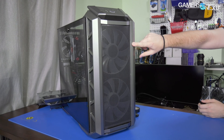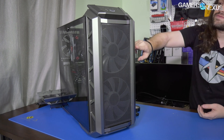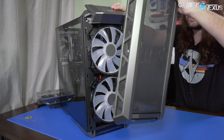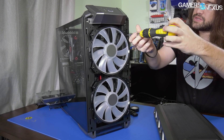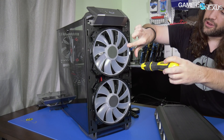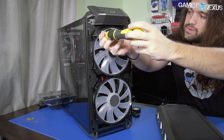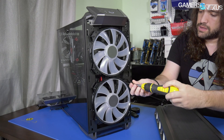Here's the thing: as a general rule of thumb, you lose about 30% of pressure for every 90-degree turn you make. This being glass, you've only got two ways of entrance here, on either side, with a little tiny bit at the top and bottom. But ultimately just the two sides of the main panel. As we showed in our review, those sides are largely covered by the fans, meaning you're really not getting a lot of airflow in there. Only the very outer edge of the blade is ever used, because it's clearly got no way to access air from outside when there's glass in front of it.